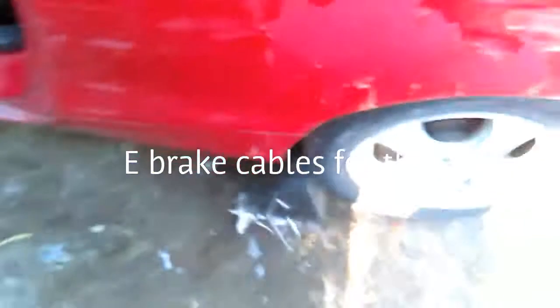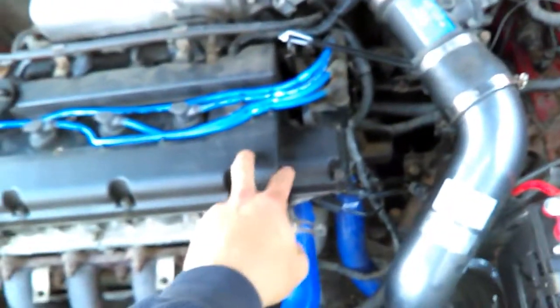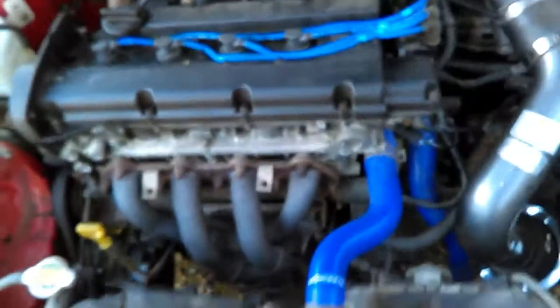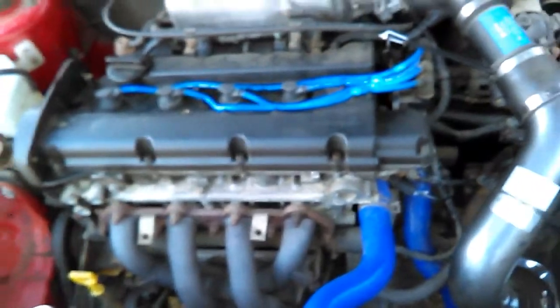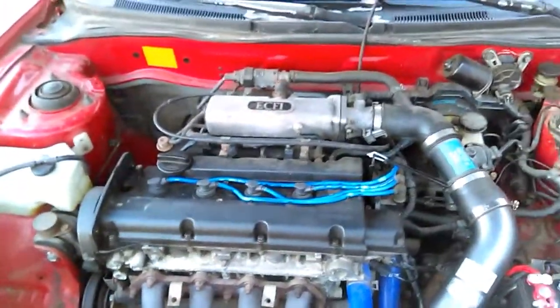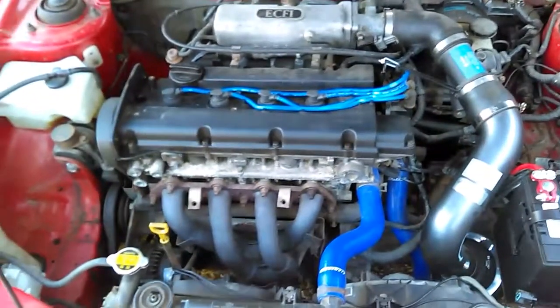Gotta get the e-brakes for this yet. At least it's running. I heard it tick a little bit — I think this thing might have a timing chain slap in it. We have a belt and a timing chain, so once the weather gets a little bit better, once I get my injectors for my RD2, we'll put this thing inside the garage, turn the stove on, and see if we need to replace that timing chain. I have several used ones here and I know they don't have slap in them. Battery's doing its job — glad of that. It's too cold, so I'm done for today. Like, subscribe, and share — let everybody know about this dumbass from PA with these Hyundais.